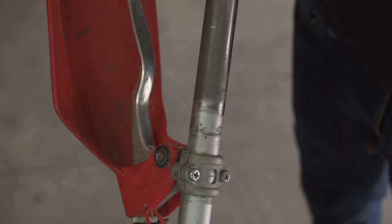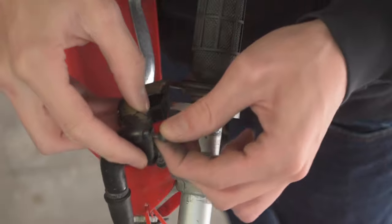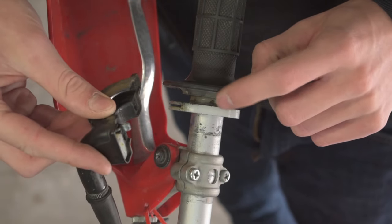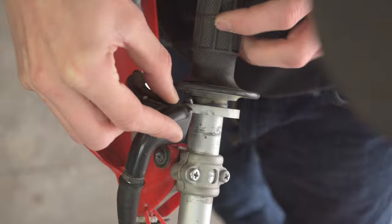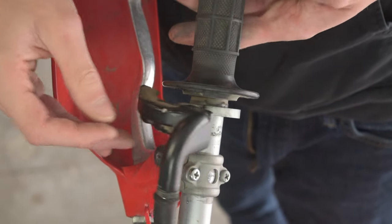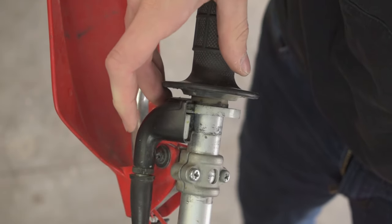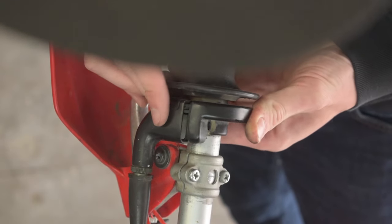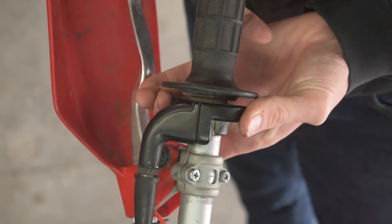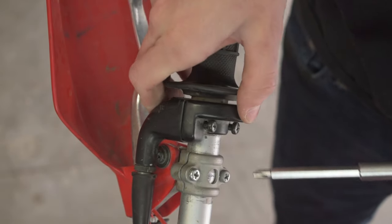Now that we've done those cleaning steps, it's time to assemble everything back together and see if it works. Take the throttle and slide it back on, then grab the section of cable with the throttle linkage. The tricky part is getting the throttle cable linkage piece to slide back into the side of the throttle and getting it straight — it can take a little bit of finagling. Once it's popped back in, the throttle cable is linked again. Sit this part back over the top of the white throttle slide, take the other half, and stick it back on. Make sure it's centered and snaps together square.